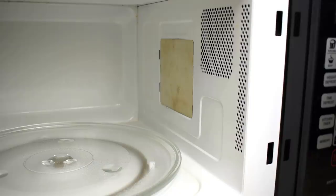One thing you never want to do is cook with nothing inside the oven. Because what can happen, the energy can reflect back into the magnetron, causing damage. You also never want to place metal objects like foil inside the oven when cooking. Doing so can create a lot of sparks and heat, and damage the oven cavity.